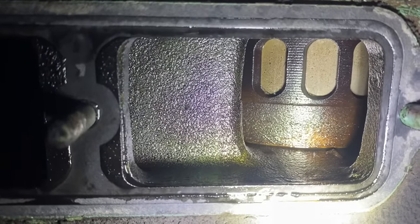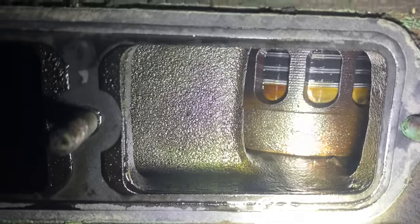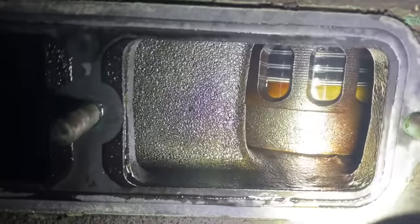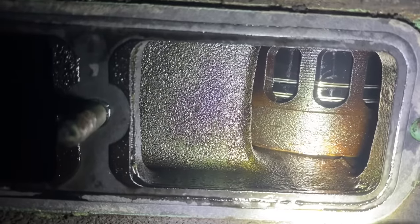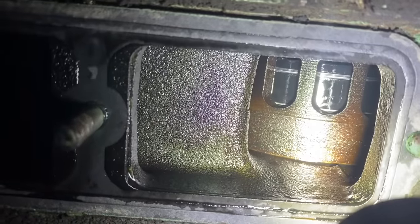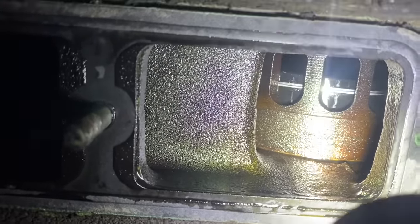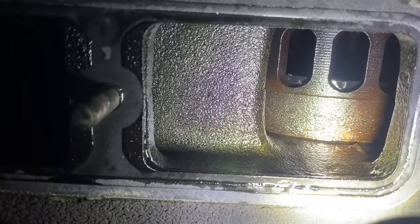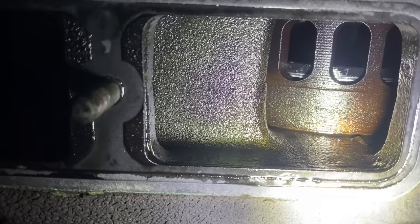Is it like some of the old engines that need zinc? It has to do with the ash content because it's two-stroke. But yeah, hang on a second. Stop right there for a second, because I can just see how much oil just came pouring down off the rings on there. Go real slow, just a little bit more. Okay. And even the top of the piston is very wet. Keep going. Just a touch more. Go backwards just a hair. Okay, we'll leave it right there for now.